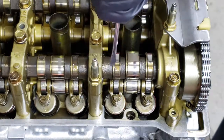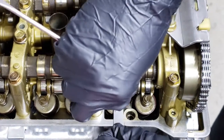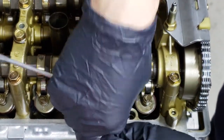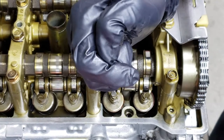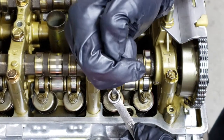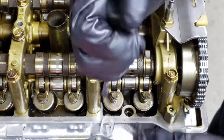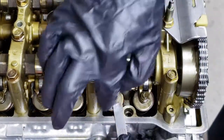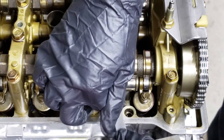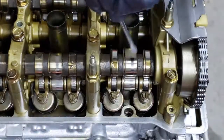The adjustment nut is really tight. Let's move the adjustment up just a bit. Just a bit of drag on it — hold it, torque it down, just check it. Make sure our 0.010 can still go in. The 0.010 goes in. I'll see if the 0.011 goes in. Okay, we can't get the 0.011 in, but we can get the 0.010 in. Yeah, that's what you're looking for.